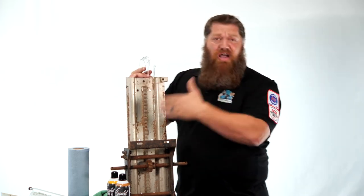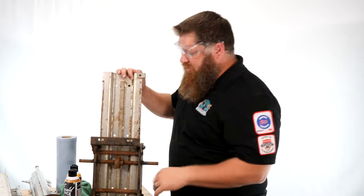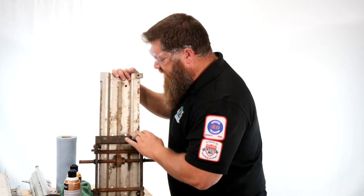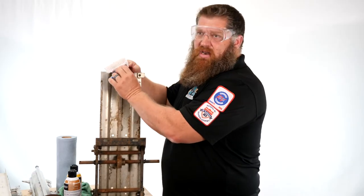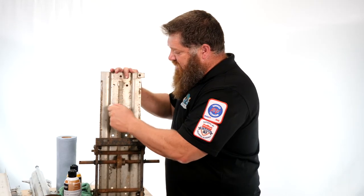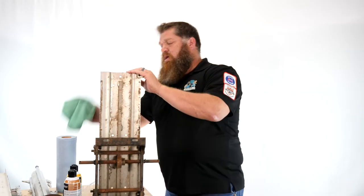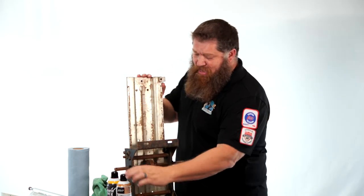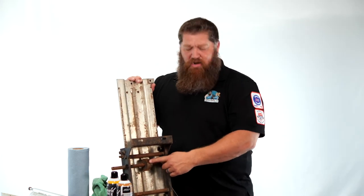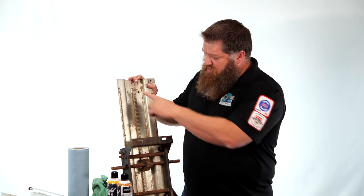Since you're underneath and going to be spraying this, get your goggles on. With your goggles, take your penetrating oil and spray all the way down your track. If it's dirty because you put grease on it or simply haven't cleaned it in a while, grab a little brush and clean the teeth off. Grab your towel, dry that off, then come back with your dry lube and spray it. When we get to our sprocket — our gear pack — make sure you don't spray that too heavily, as it can still gum things up. Just clean the track.